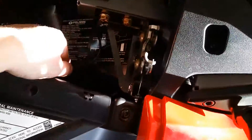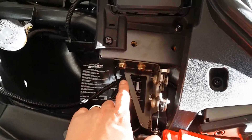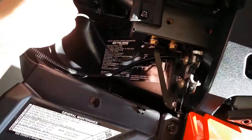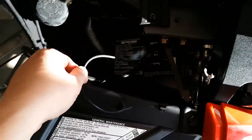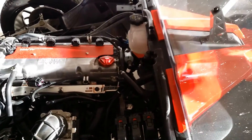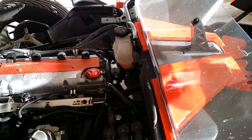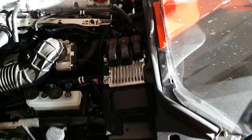For the ground, there are a couple of bolts here for the hood latch on the driver's side. I took out the front one and mounted my ground right there. The ground wire doesn't need to be long since the fuse box is going to be right here. I'm going to wrap this with looming before I'm finished so it looks factory. Next I'm going to tap off the positive lead on the cigarette lighter to get my ignition switch signal for the fuse block.